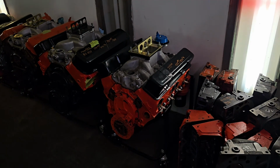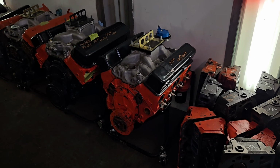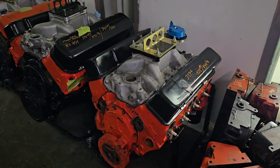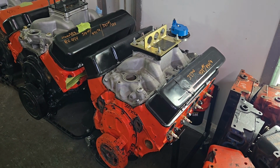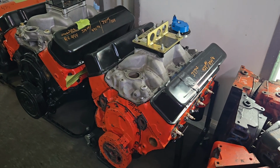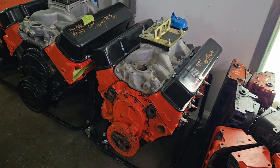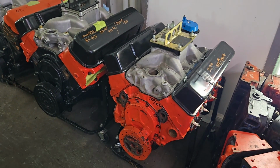Okay, I'm not going to explore all the motors that I have here in my shop, but I will show you what I've got uncovered here in the storage room right now. That is my 357 small block Chevy. It has made as much as 437 horsepower with a hydraulic roller, Extreme Energy 224, 230 at 50 thousandths. I currently have double humps on it and am preparing to dyno test it sometime soon. I'm hoping for around 400 horse with this setup.